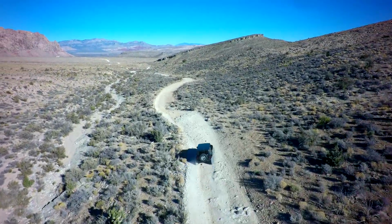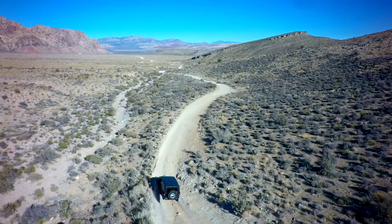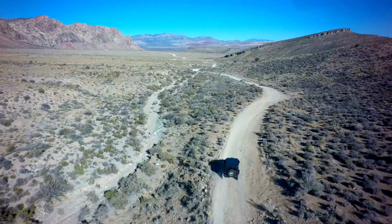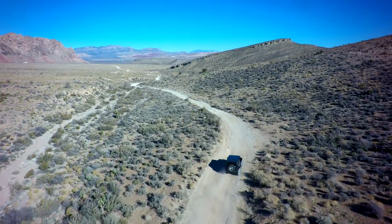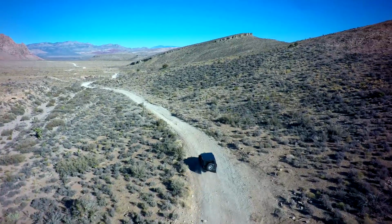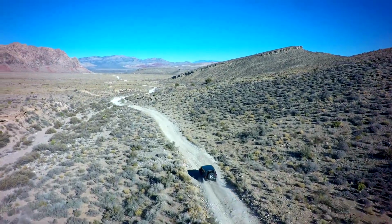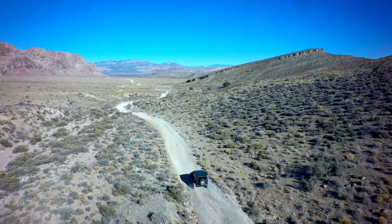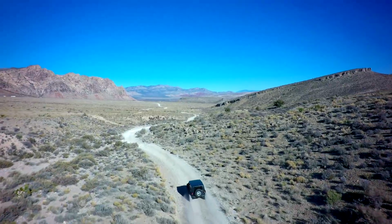A lot of that time we are in DOD, or 4-cylinder mode. My wife doesn't know she's in 4-cylinder mode. You can feel a very slight vibration, but it is in 4-cylinder mode quite a bit, and that Jeep is being benefited by AFM. Now, we're not talking double-digit numbers here. In my opinion, you might be getting 5% better mileage. If you really concentrate and work the throttle so that you stay in DOD, you might get 10%.